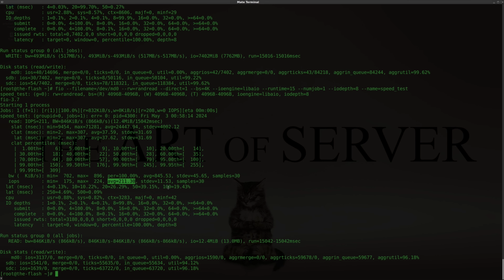I think the exciting part for me is that this allows hard drive technology to really take a huge leap in performance, above where most standard hard drives are. They've been stuck somewhere around the 250 megabytes per second bandwidth range for many years. As platter densities have improved over time, that's crept up a little bit, but it's really been tiny incremental steps, while this Mach.2 technology is a significant leap forward in terms of throughput. And even in the IOPS arena, this is definitely a huge improvement as well. So yeah, I'm actually pretty impressed with this stuff.